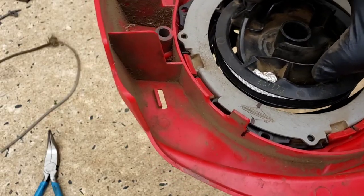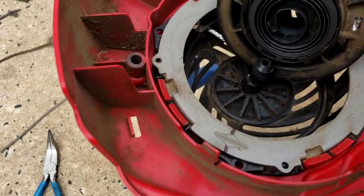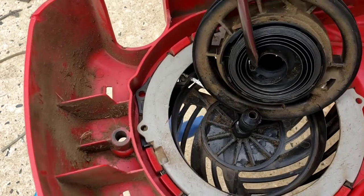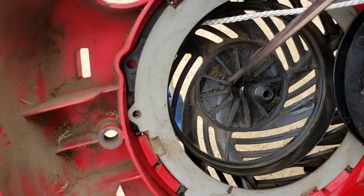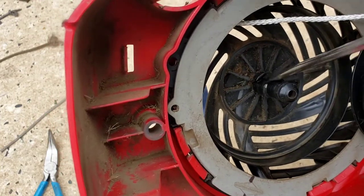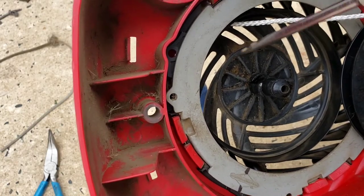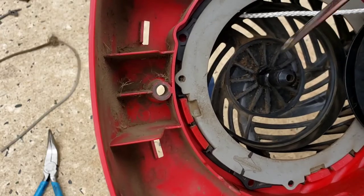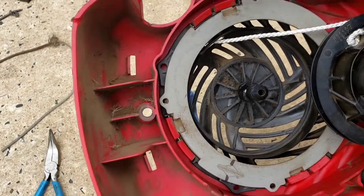That spring sound means the spring that was in there sprung and turned all the way around. I'm gonna pull this out and show you: this flat spot on the spring is gonna lay in the slot that's in here. See, I can put the screwdriver in it — that's gonna fit right in that little slot. When you put it back, that spring has to sit in that spot. That spot holds the spring while the other piece turns. If you miss it, the whole thing is gonna spin and you won't get that return.